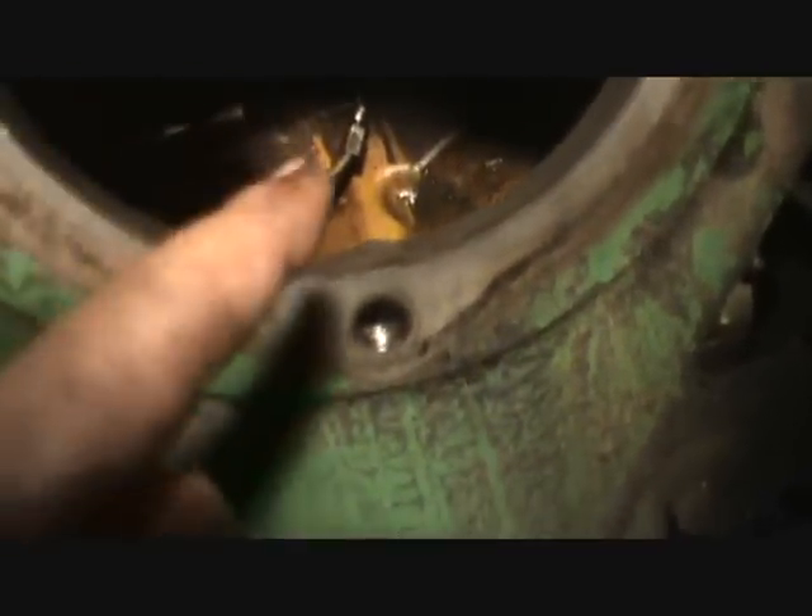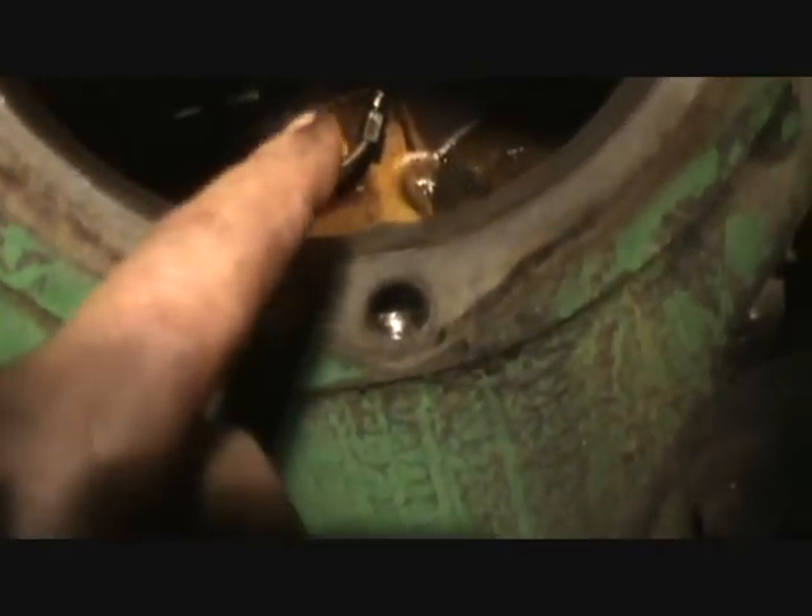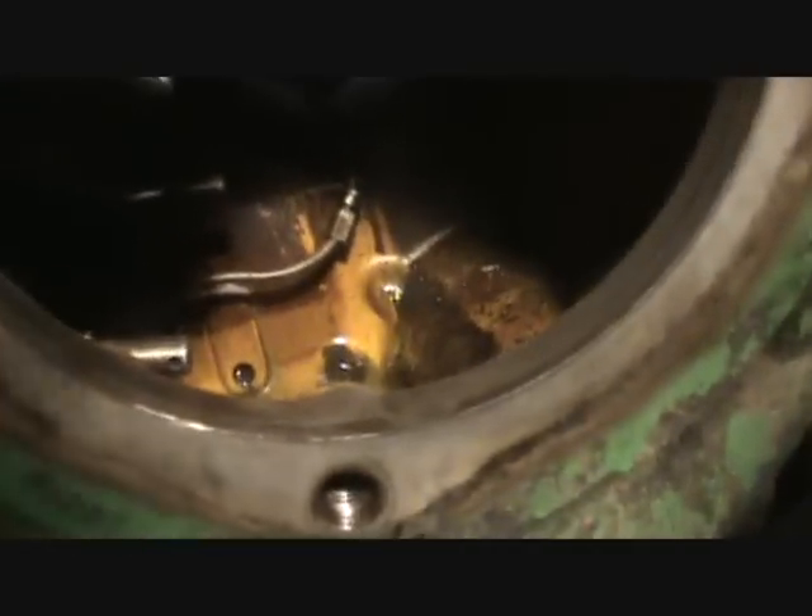Pretty simple - I'm just going to scrape it out and down the hole into the pot to collect down there. Tomorrow, because we're about done for tonight, we're going to take some diesel fuel and wash it down in there and clean it out as best we can. I don't want my new bearings and connecting rod going into all that sludge.